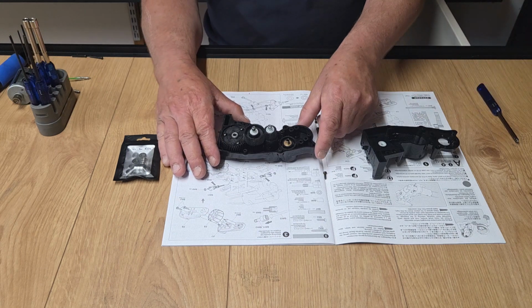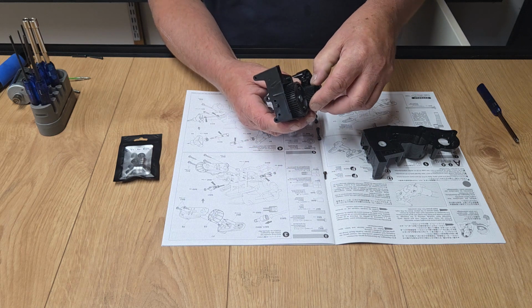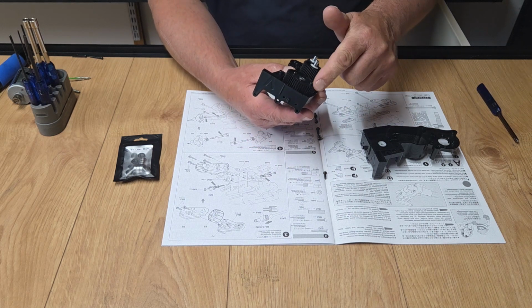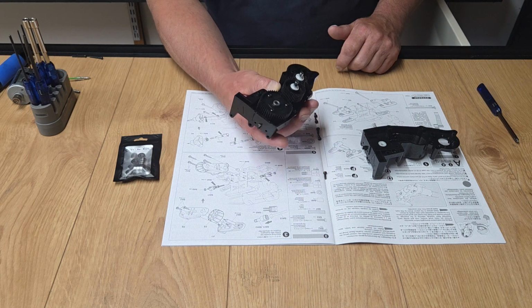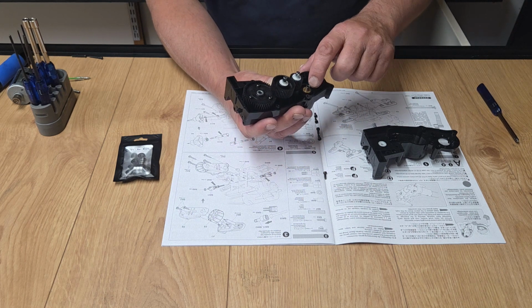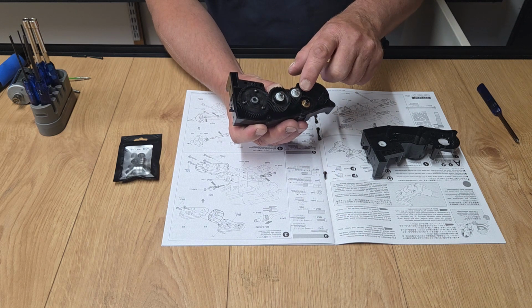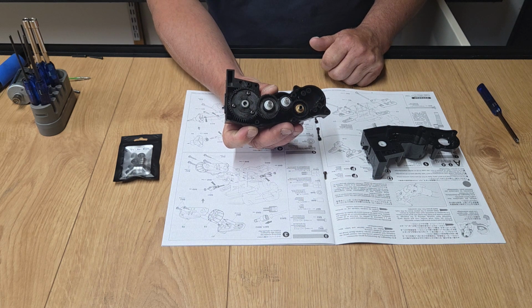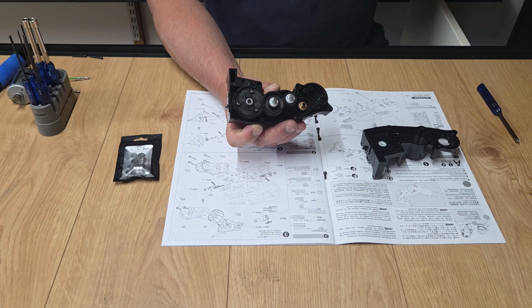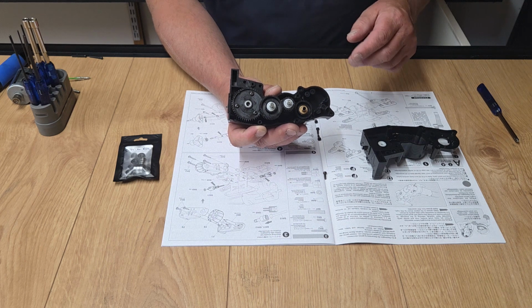Here we have the gearbox case cracked open now, and as you can see you've got very hard plastic gears in there. I'm assuming a 3 bevel differential inside the big gear at the end. The idler's got a brass bushing, and all the other idler shafts are running on the plastic bushes that Tamiya supply. So I'll replace all of these with some metal bearings with the rubber shield, and show you what they look like when all the bearings are put in.